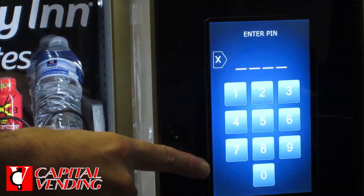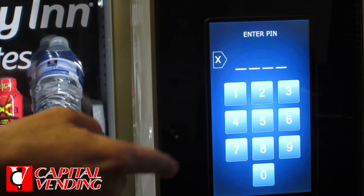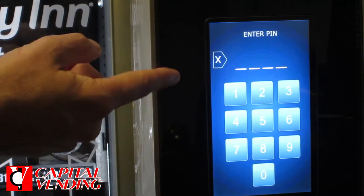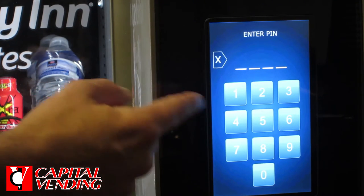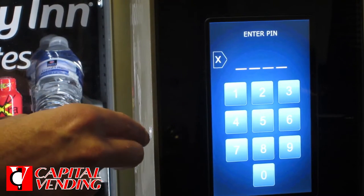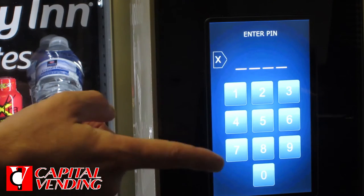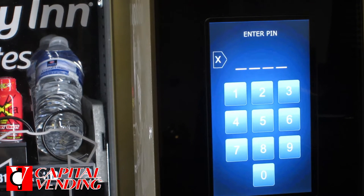This is still giving us some loading. Near the end it restored the LED lighting. Basically now it's complete. I'm going to go ahead and close the door and then you'll be ready to use. If you've done the full reset, you're going to need to enter your pin number and reconfigure it with your prices and any devices you have installed. But if all you did was the save or preserve, at this point you're done. I definitely recommend running money through it, doing a full test, and testing the guaranteed vend just to be sure.